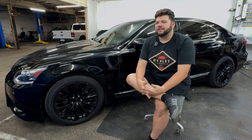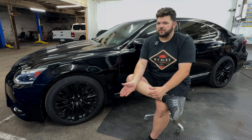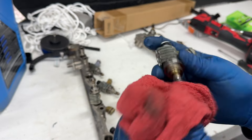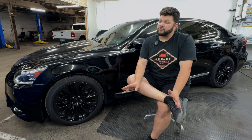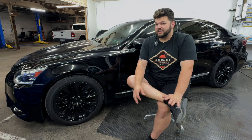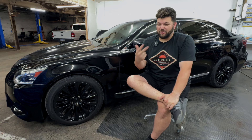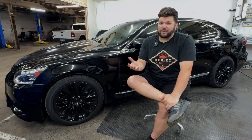I think it's because I was trying to save money, not spend extra money — kind of leave the driver's side alone since there was nothing wrong with it and just do the passenger side. But I also took out the driver's side. The only reason I would have removed them is if I broke the connectors, and unfortunately they get very brittle and break. So that's why I removed them — if you don't have to touch them, don't. That's my advice. Everything was removed and replaced multiple times. Fourth time's the charm, I guess, because now they're all lubed up correctly, all brown, all low mileage brown injectors — and it runs great now.